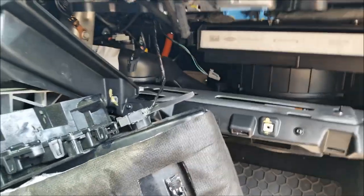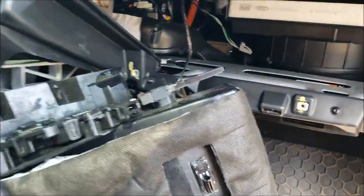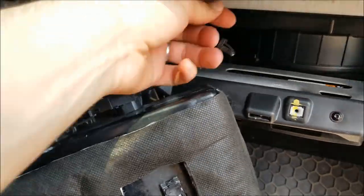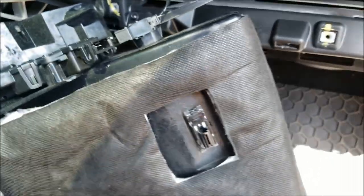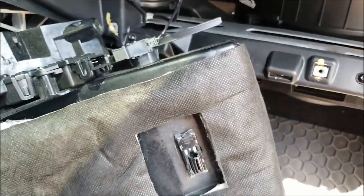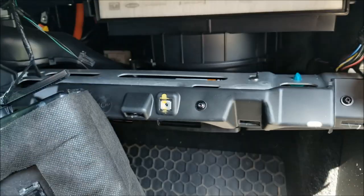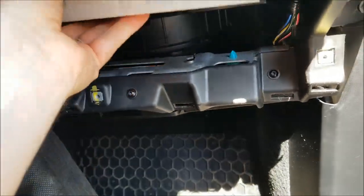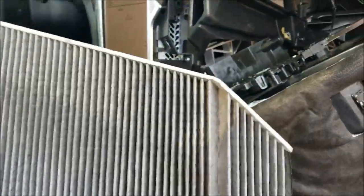Okay, so I went ahead and just dropped the glove box on down here. There are three connectors that you have to disconnect if you want to take them completely out. I got two of them off. This third one looks like some sort of proprietary connector, and I'm having a heck of a time getting it out, and quite frankly, it's not worth any more effort with how much fun this has been as it is, because now you can see that you can clearly get to this. I already took the cover off of it. It just comes off, and right out here comes our air filter,